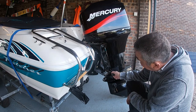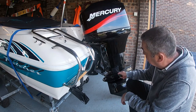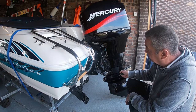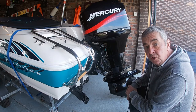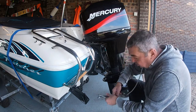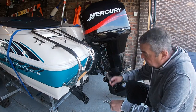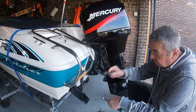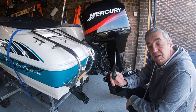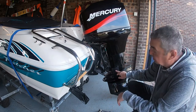What we did some time ago was cut the engine mounting bolts and when we put the new ones in we put them in from this end, so the nut is on this end. That means we can remove the bolts, remove the engine mounts and change them. What you're going to need to do this job, if you've done the modification: a half-inch socket, a 19-millimeter socket, a 19mm open-ended ring spanner, and a Phillips screwdriver. That's it — you don't need anything else.